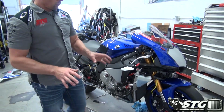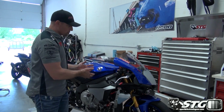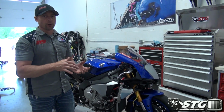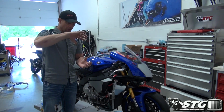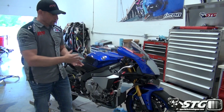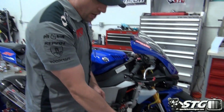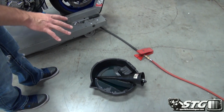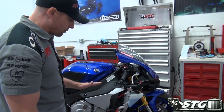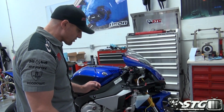Okay. You need to run the motorcycle, right? At first, it's going to get warm, okay? You're going to see it climb, probably just a little over, right around 230, and then it's going to begin to cool down, right? That thermostat's going to open up, the coolant's going to flow, your fans are going to come around 220, and it's going to stabilize. You can clearly see we have a little bit of coolant left in the drain pan. Remember, this all came out of the motorcycle, and the system was perfectly topped off, right? Perfect fluid level. We lost very little spillage, okay, just a little bit.